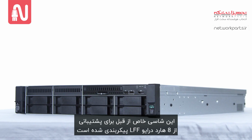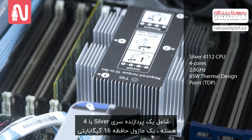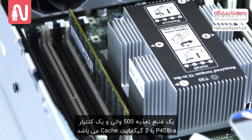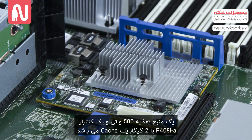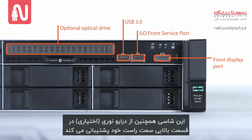This particular chassis is pre-configured at the factory and supports up to 8 large form-factor hard drives, a single scalable silver CPU with 4 cores, a single dual-rank 16GB memory module, a single 500-watt PSU, and a P408i 2GB HD controller. This chassis will also support an optional optical drive carrier in the upper right front of the chassis.